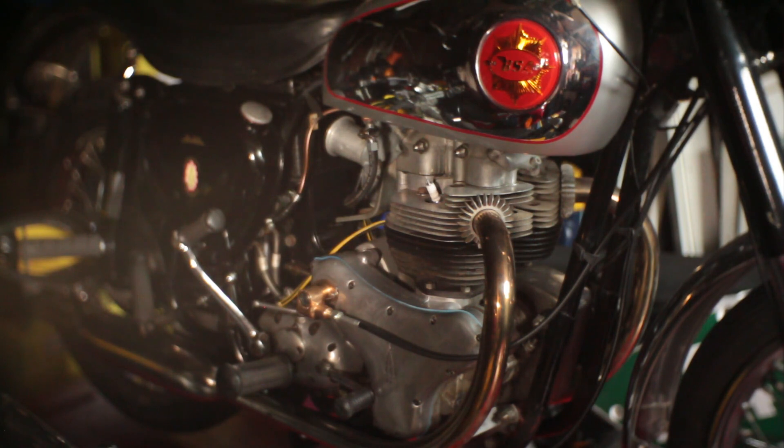I really thought it's probably time — and it didn't get ridden a lot; I think I've done like six, seven, eight thousand miles on it in total in all that time, so pretty much nothing. I decided I probably should — you probably know that they have a sludge trap in the crankshaft, a tube that goes through the crankshaft, and it has a sludge trap where it traps all the muck and debris that's in the oil. There's no proper oil filter in it. Over the years that sludge can build up, and I realised I probably should clean it out, as it's probably well overdue.